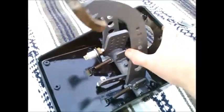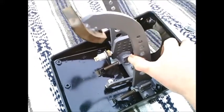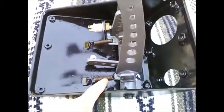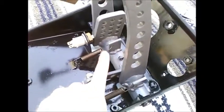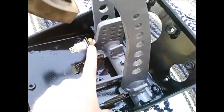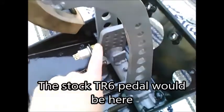It's basically two pedals on a common shaft, so pressing either pedal will work the brakes. To bring the assembly back I've got these little pseudo pedals for the stock springs to hook onto. I've got the stock brake light switch, and I bent the tab a little bit because this lever is much wider than the pedal.